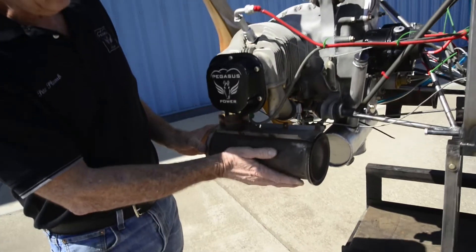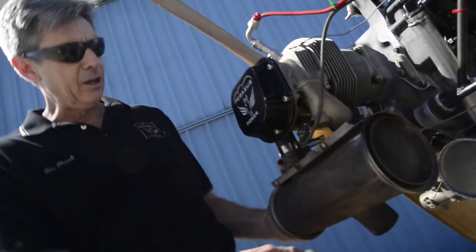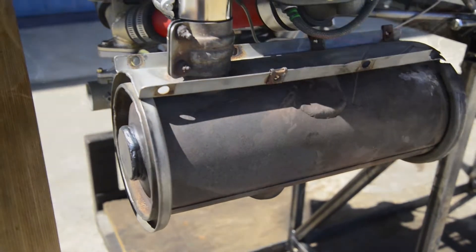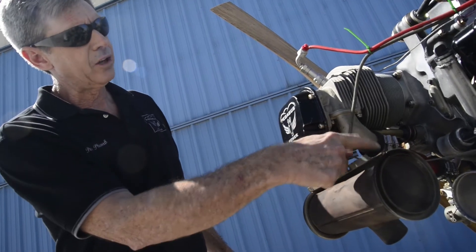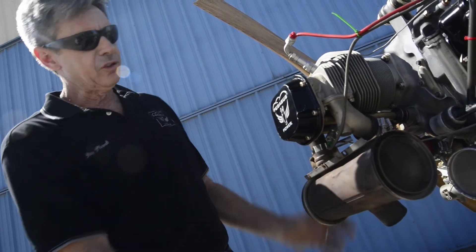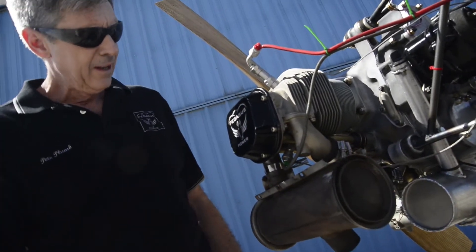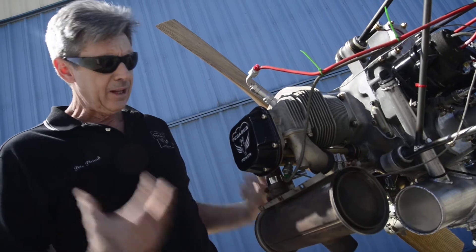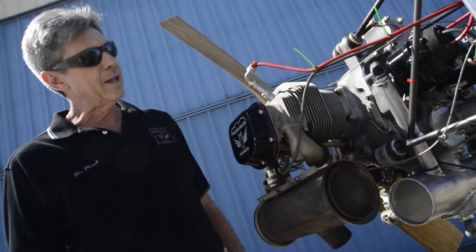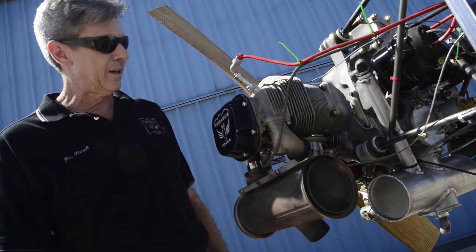What you'll see here is a muffler off of an O200 — a stock O200 muffler that I modified by capping off the other exhaust manifold. On the other side I used the remaining one, and there's one that comes out the top that is capped off as well. It was a very simple solution as I scratched my head wondering how I was going to get this exhaust system worked up. I was already excited about starting the engine and this was a simple solution — it just went right on. The thing runs very quiet and it maybe robs it a little bit of power, but we're okay for the test.